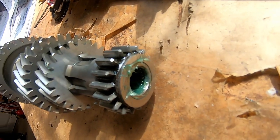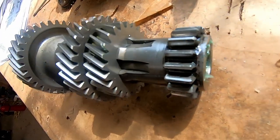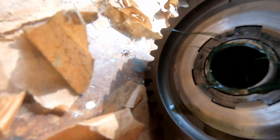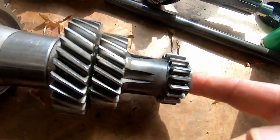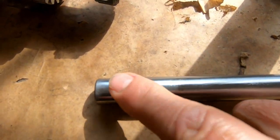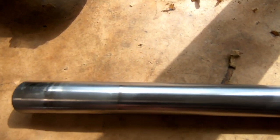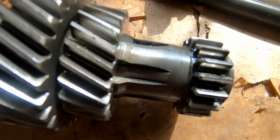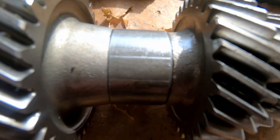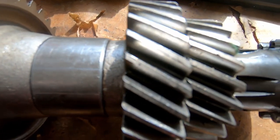Now that I've gotten grease inside of the needles themselves, hopefully those needles will stay put on either end of the shaft when I put this into the gearbox. The actual shaft that goes inside here is out, and I've examined the shaft itself and it looks to be in fine shape. One little trick that a guy told me is just take your fingernail and rub it along the shaft and see if you can feel any fine gouges or any grooves in the shaft itself. I'm not feeling any, so I think our shaft is good.